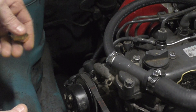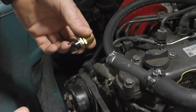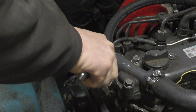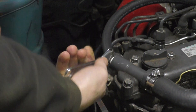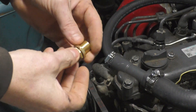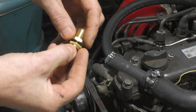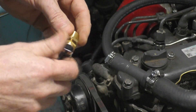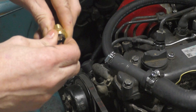I'm gonna go ahead and finish off the wires for the fan control. Got this switch to turn the fan on and off. I'm gonna put it right here in the thermostat housing, using my all-16s. A nice thing about this sensor or switch is there's actually no hole in here - it just screws into the end, so if you ever have to change it you're not gonna drain any cooling or anything. Never used this style, so I guess we'll see how well it works.